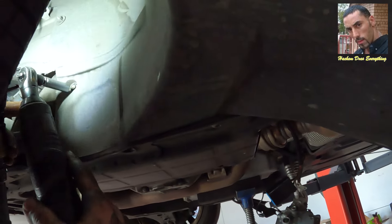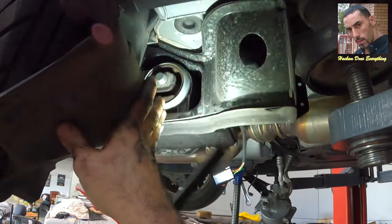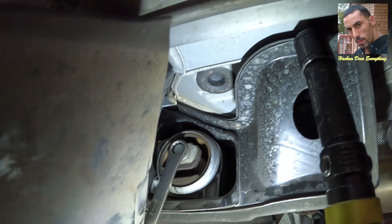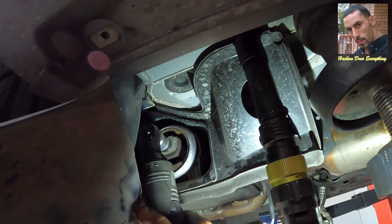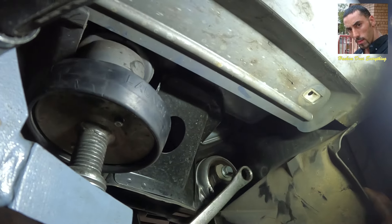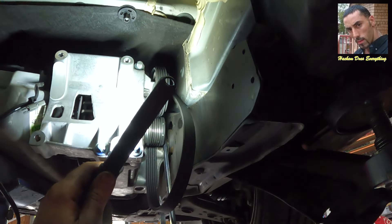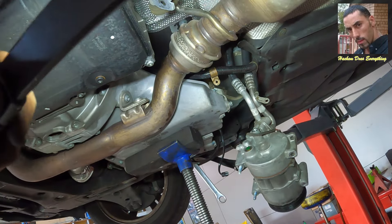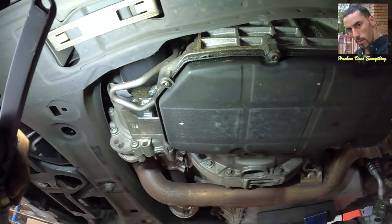There are three bolts on each side. I'm taking off the bolts so I can move the plastic back a little to reach the engine mount bolt. The other side is the same. I'm taking off these two bolts to bring the engine down and reach the starter motor. Some people remove the engine outside the car to change the starter motor, but this way is much easier. See how I use a big screwdriver to move the two engine mounts — the engine is going slowly down.